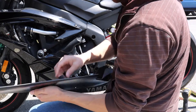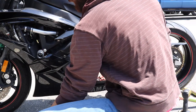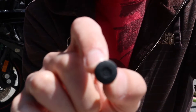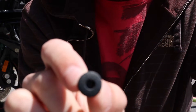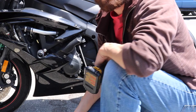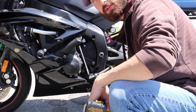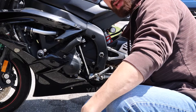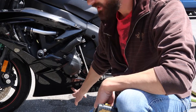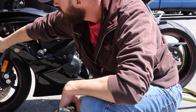First panel's off. There's a small black push pin right here. I'm just going to push in on the center of it. When you get to it, it's going to look flush. All you're going to do is take a screwdriver or something, push on the center of it — that's going to open it up and allow you to pull it straight up. The next step is going to be removing this main left side fairing. It's going to be a couple of these number four allen bolts — one on the very back at the bottom, one up here in the very front, one in the center, and then one small one up here on the front that you have to come in from the side.